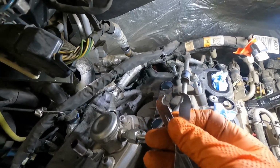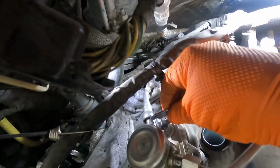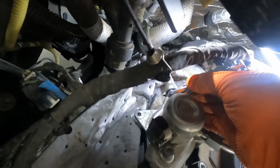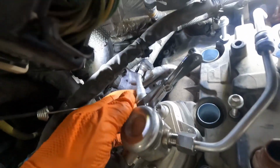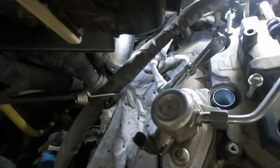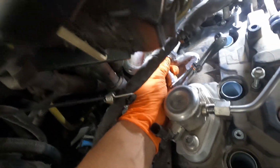They've also got little plastic ones, but basically you need to find the right size to go around your fuel line here and close up. Try and get you where you can see. Hopefully that's visible. Once it closes around the fuel line, you want to wiggle it and push it into the fuel line right there. And then whenever it goes inside, then you can wiggle off the hose. There we go. And then I've got this towel down here to catch the mess.